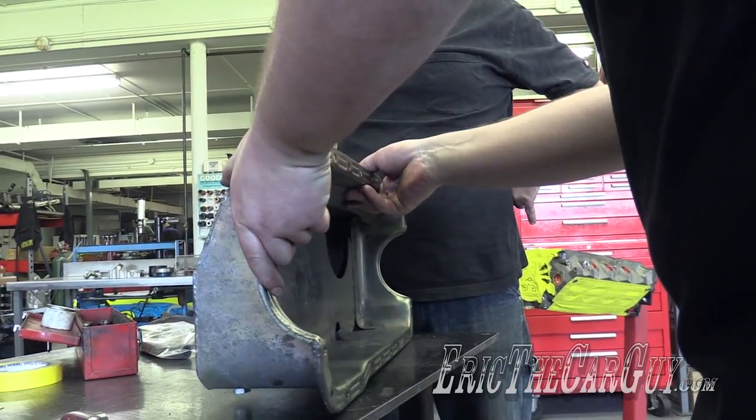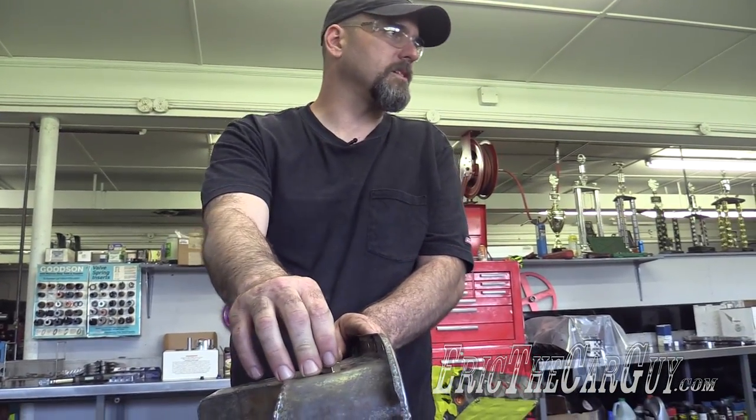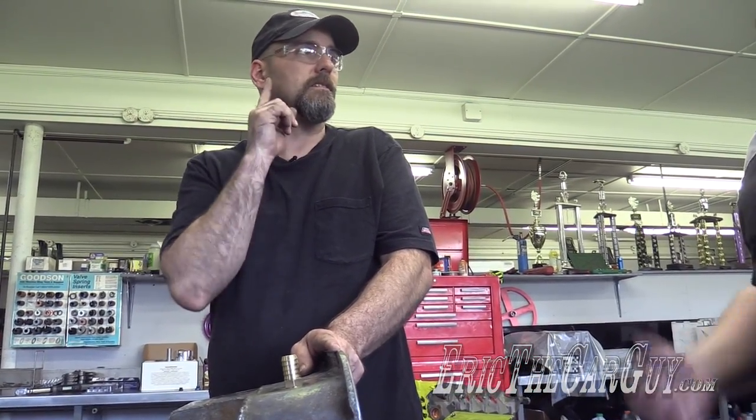My concern is for sealing, obviously. Would it be worth using silicone? I almost think once that's run down, the brass will sort of conform. I'm thinking if we put some Teflon tape on here, maybe? Or should we just put sealer on here? I think just sealer, actually, because you don't want Teflon tape in the oil pan. A little sealer — sealer's fine. Maybe a little bit of silicone for extra protection.